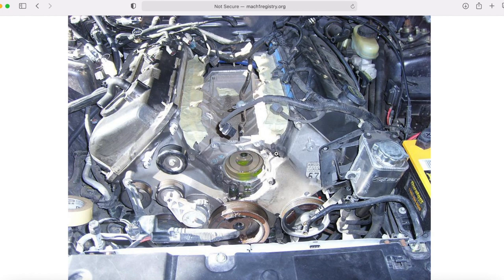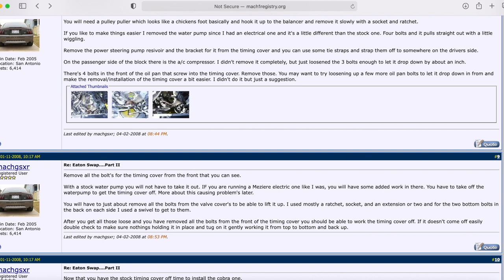My recommendation: where the cylinder heads meet the block at the head gasket, make sure you apply a good bead of black RTV at those spots as well. If your head gasket isn't flush forward with the block and heads and there's a small gap, you're going to have an oil leak. I've got a slight leak on mine at that spot that I'll need to fix this winter when I pull the timing cover. After I put on catch cans it's not leaking badly, but it still bothers me.